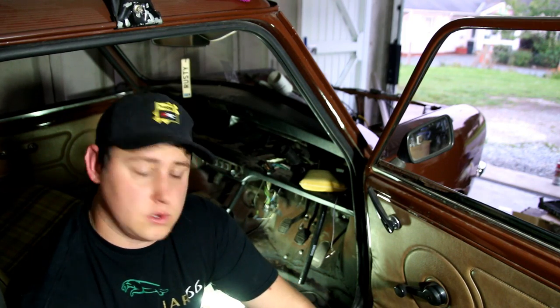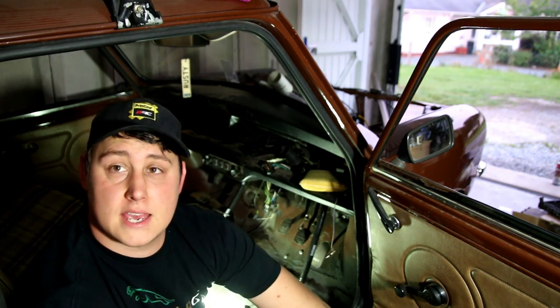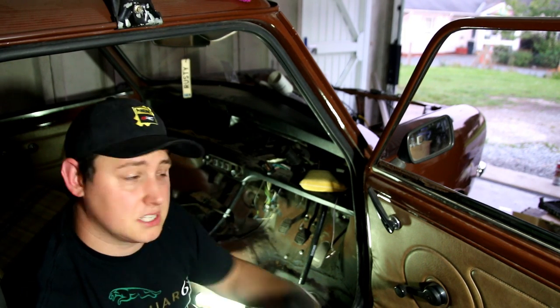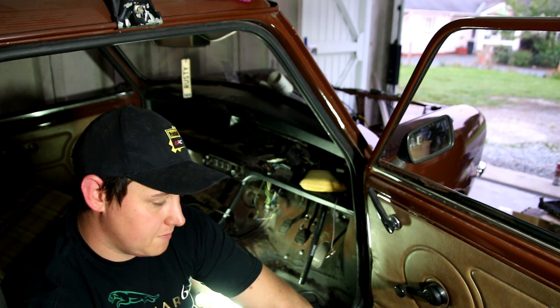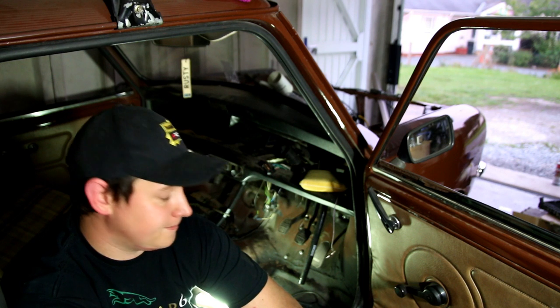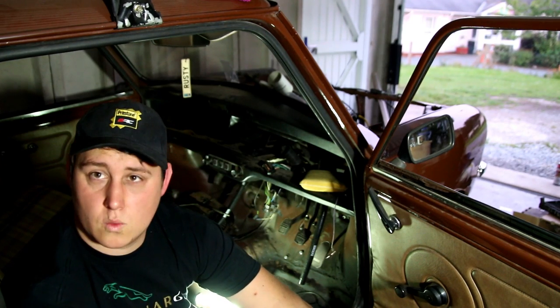So there's a few jobs I wanted to do, which I've turned my attention to off camera. Now the reason being, they are the brake and the clutch clevis pins, and they've got the split pin to go through. What a pain of a job they are. When I did the clutch clevis pin previously, before I changed the plate underneath, it went in an absolute doddle. Put the two in, nightmare. So the steering column came back out, even though that was just being held in with a screwdriver. So anyway, we are getting somewhere.